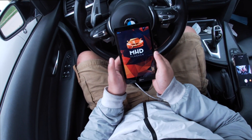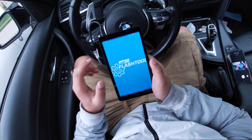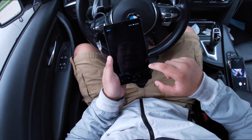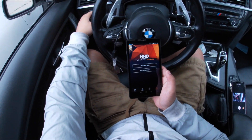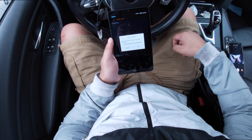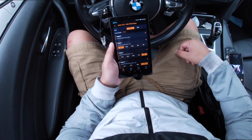I'm going to take you through the whole process of tuning your car. Open up the app — you've got the home menu. If you're flashing your car for the first time, make sure you have a battery charger connected. Turn accessory mode on, make sure AC is not running, turn off your other lights, click Tune, then click Flash MHD Map. I'm currently running a Stage 2 Plus tune with E30.